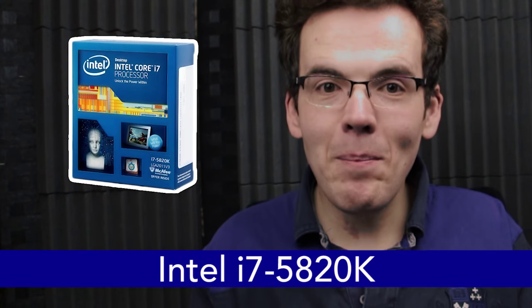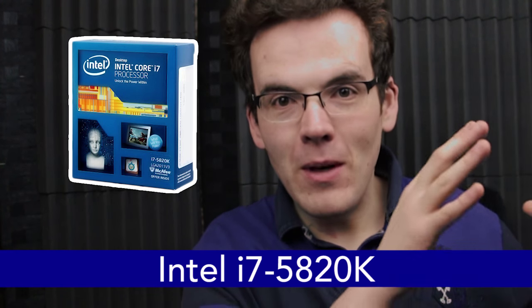For the processor, I've gone down from the 5960X and even the 5930K, because I'm only planning to run one, maybe two graphics cards, and those other processors are geared towards three and four graphics card solutions. I'm going down to the 5820K. I'm planning to overclock it, of course. It's still six cores, which is two more than mainstream i7 processors. It'll also give me a good foothold when it comes to 3D graphics for Team 4 Star. It's overclockable, so this will do me just fine for several years.